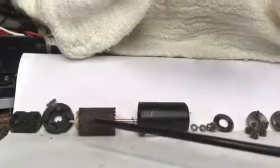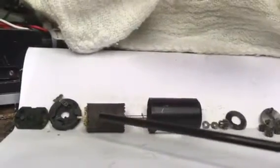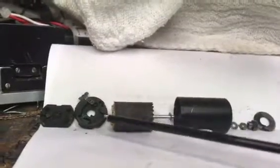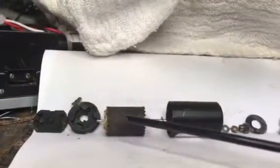The grease is filling the motor all around with liquefied grease, which causes too much torque on the motor. Then the motor burns the brushes out that are supposed to be riding on the commutator, and then the motor quits working.